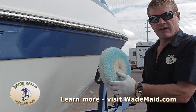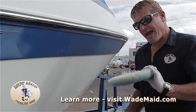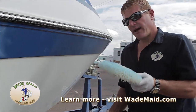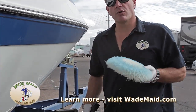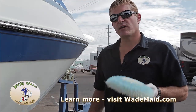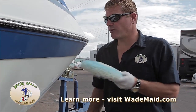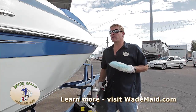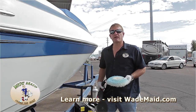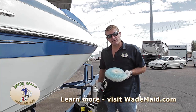This is our cutting side. The pad we use is about a seven-inch cutting pad. A seven-inch wool cutting pad is what you need for this process and with fiberglass. Don't be concerned about using foam — don't get fancy and use a finishing pad. You want a true cutting pad.